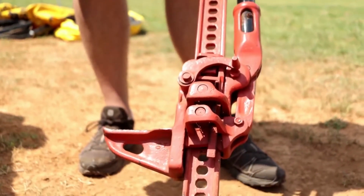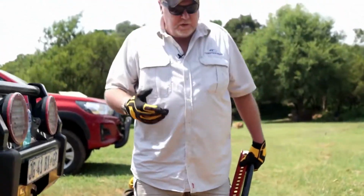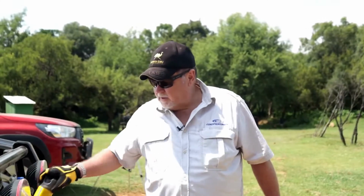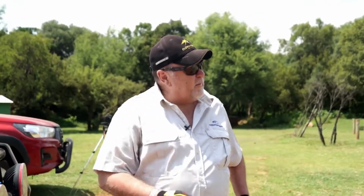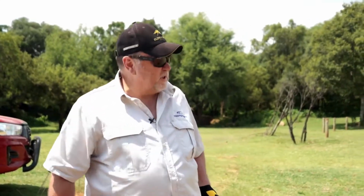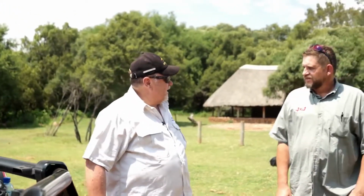What is probably going to be the most used way of lubricating those pins? Probably oil, 220 or something like that. And that's exactly where the problem comes in, guys. Any lubrication that has an oil base is going to attract dust. So where's this thing normally sit on your car? On the back, on the side, on the top. I've seen people mount them on the front. And a nice missile in the case of an accident.